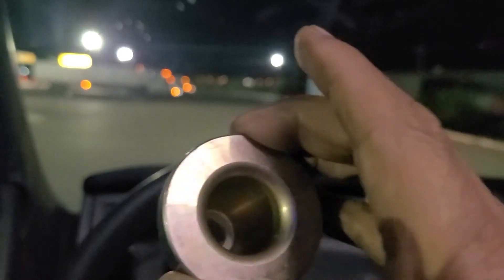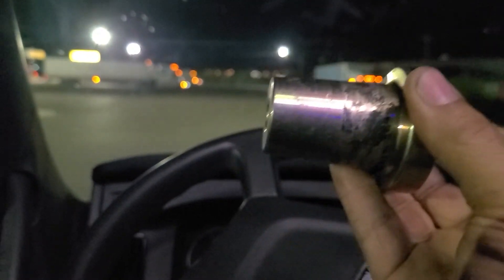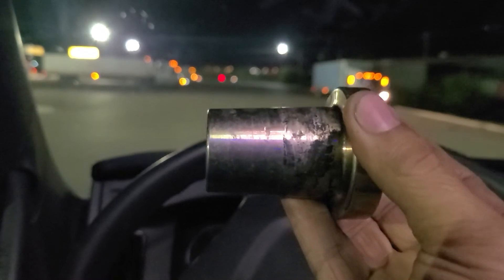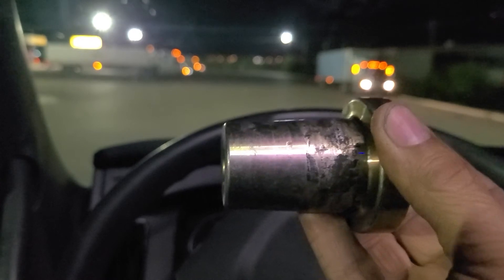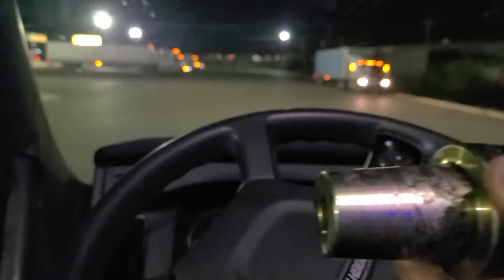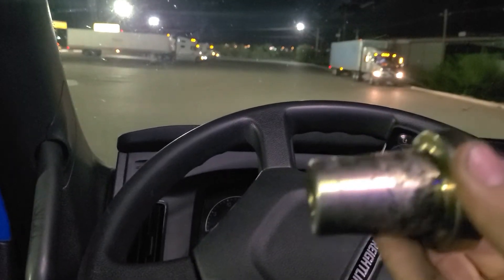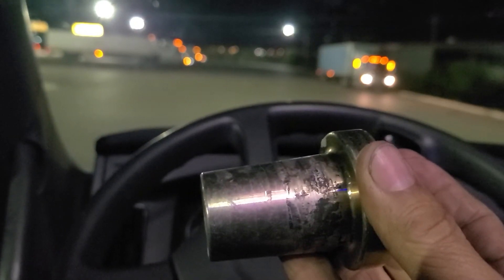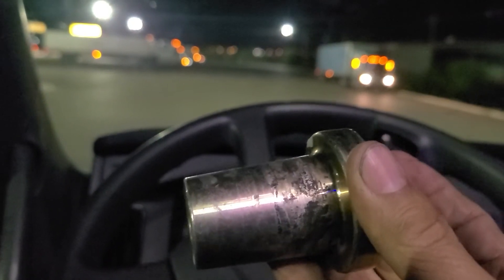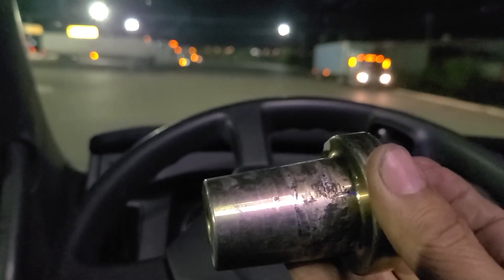So this thing right here, you just slide it in the one hole in front of the hole you want to put it in. Say you want to put it in a California hole, the seventh pin. You'll slide your tandems beyond the seventh hole. You'll put this in the sixth hole. You'll slide your trailer and hit up against it.